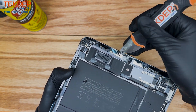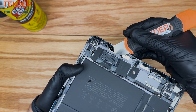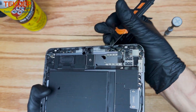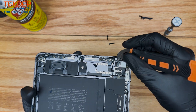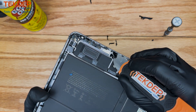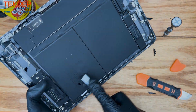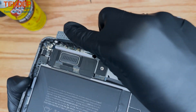And then eventually most of the glue off of the frame as well. Interestingly, this is a cellular model — we've done a teardown of this device before, I'll link that in the description. And the interesting thing is that this model is totally different than the Wi-Fi version; there are a bunch of coaxial cables not present in the Wi-Fi only version. The bulk of this repair is dealing with the glue and the glass. This device is rated IP68, and there is a lot of glue. It's imperative that you are patient — using the brush, some goof off, some isopropyl, an X-Acto knife, the spudging tool — anything you can to get that glue separated from the frame.